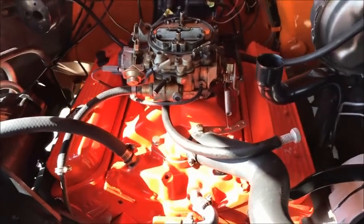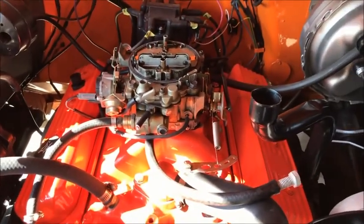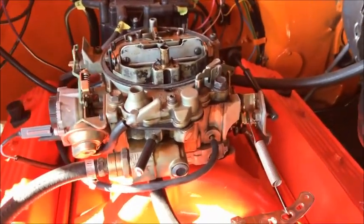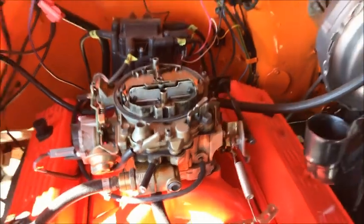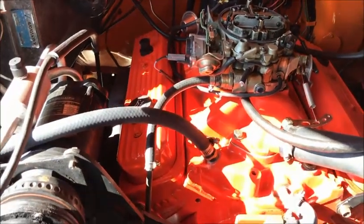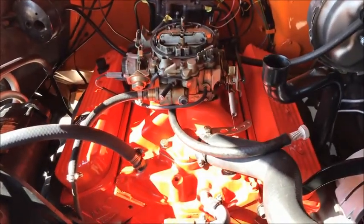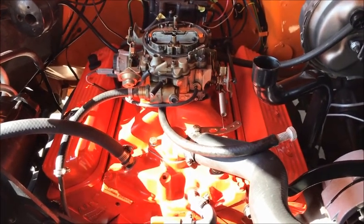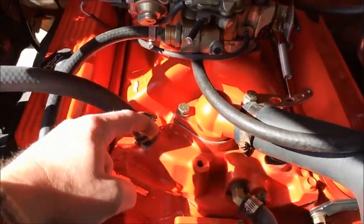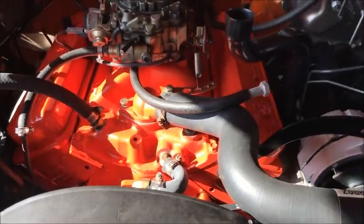The reason I'm doing this is because I did a smoke test not too long ago, and I had quite a lot of smoke coming out when I was plumbing it into my regular booster line. I was finding vacuum leaks and I was getting a lot of smoke through my valve cover, which could be going through the valve guides and the valve seals. I wouldn't expect that much, especially out of a random motor. So I thought I'd do a vacuum check on the crankcase itself to verify whether or not we actually have an intake manifold leak into the crankcase — like the lower part of the intake manifold gasket down in here, maybe it's leaking into the engine block.